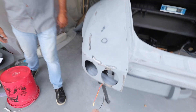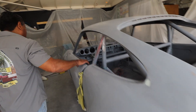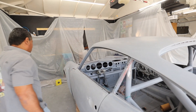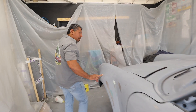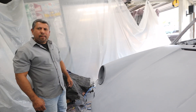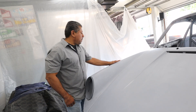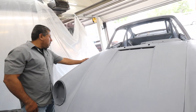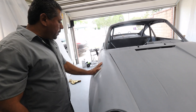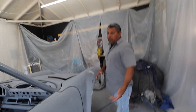Here it is in all its glory. Look at my little metal work — I'm impressed, not bad for a hack. I haven't sanded the interior at all, this is just exterior work. What grit are you finished at right now? 240. I did 240 because I wasn't sure if I was going to need another layer of primer or if this is good enough to put a sealer on. There are still a couple spots I feel I might put some glazing on.